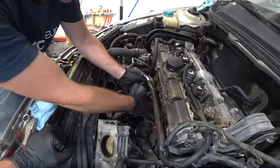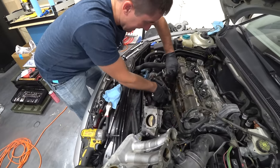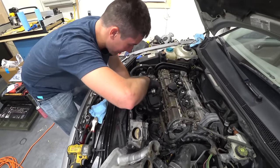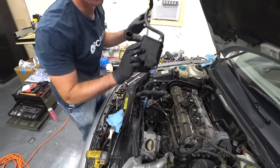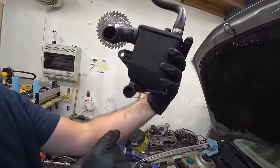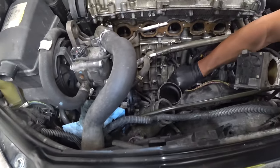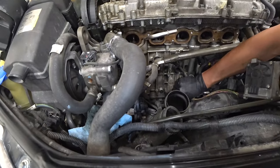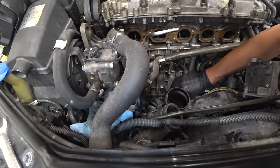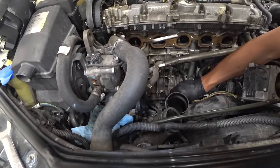There's the headway we needed. Now I have to get this hose out, drop the hose to the throttle — the clamp to the throttle body just fell. We got this off. Look at all that carbon. Holy — that thing is toast. I don't know how well you'll be able to see that, but it's just completely clogged. Just pry them out in chunks. There is nothing getting through that. No wonder the thing blew out the cam seals.